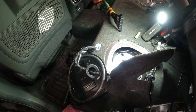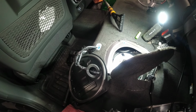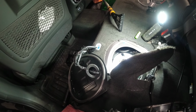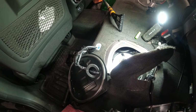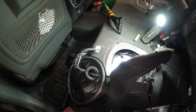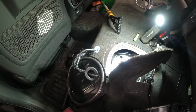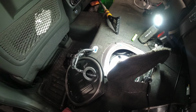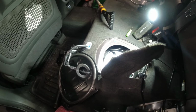to remove anything in the subframe area or the rear differential. There's some models in the Genesis where you have no choice but to move those because there's no space. In this case here, I think I just have to remove the exhaust assembly, the propeller shaft, and whatever covers are there, and then we can start removing this tank, and we'll see, and then we'll get back.